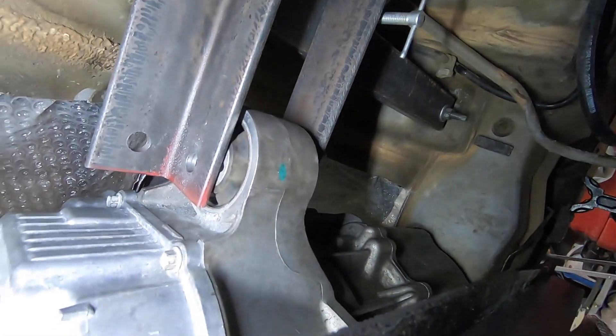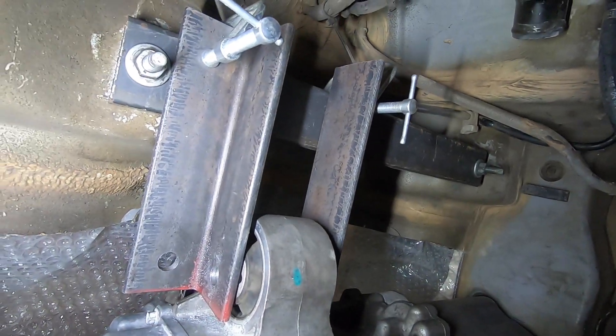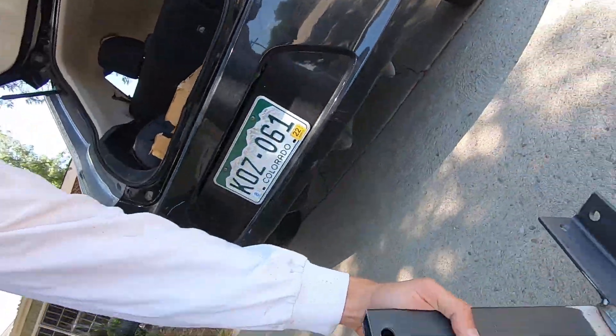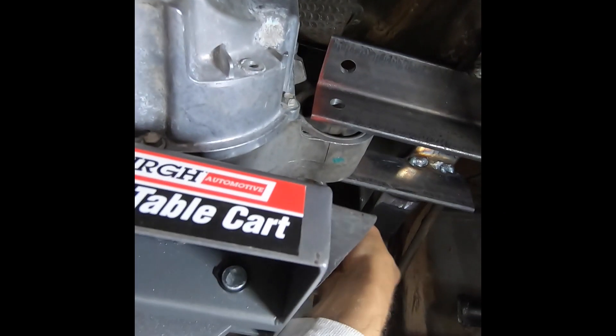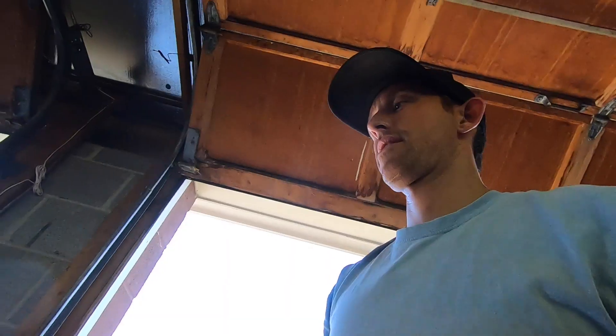You can see the motor needs to slide up a little bit more. I could have put these angle pieces on top or bottom, but I want to keep the center of gravity low on this car as much as possible — it will handle better the lower all the masses are. I got the front motor mount welded up — check it out. There she is all welded up. The front is bolted all the way through. It's not totally done but it's pretty dang close. So now I'm just going to clean the garage — it's just a disaster. You know that nice feeling when you clean? I need that right now. I need some mental composure.